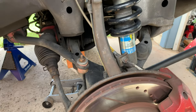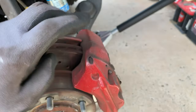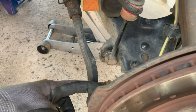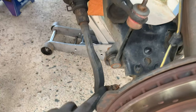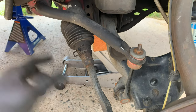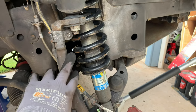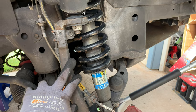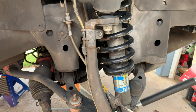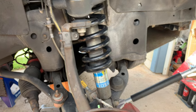This is one of those things you do while you're in here. I'm gonna take off the brake caliper, undo the sway bar, undo the outer steering tie rod. What I'm gonna do is change the outer tie rod and the inner tie rod — just unbolt it, take off the spindle, then take the spindle down to D's Automotive. Darryl's gonna do all the fabrication and welding for the gussets, which should solve the problem of any flex and potential breakages.